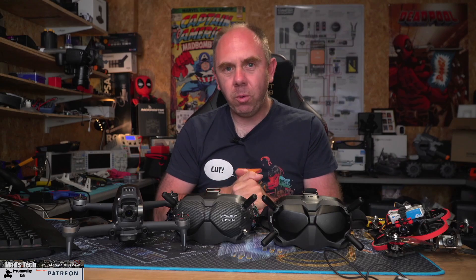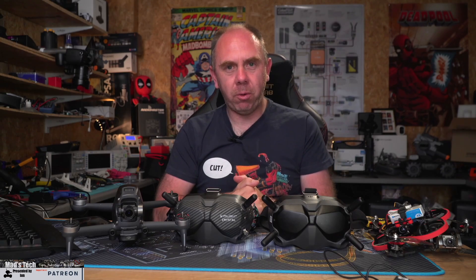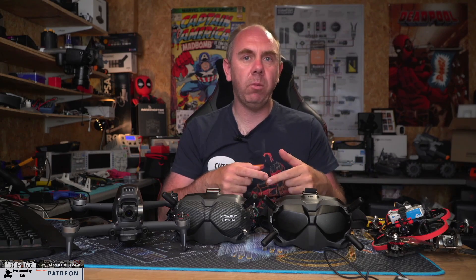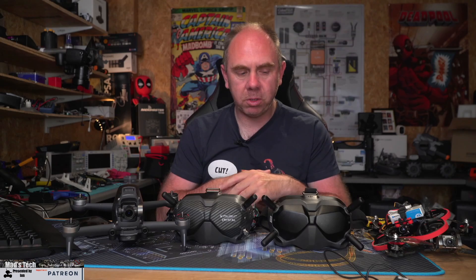As you can see it is pretty horrible behavior overall when they enter low battery. It is the same on the new firmware — they still do this cycling thing when it gets to about 5.2 volts — however they do reboot into the proper mode now in my tests at least.